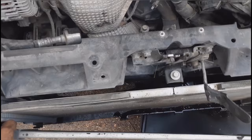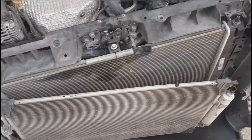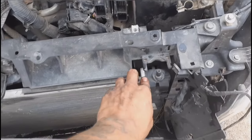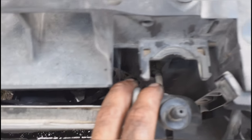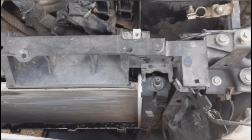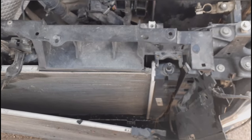After that it's pretty easy to remove — everything is already taken out. Just go ahead and take it out of the way and remove the radiator. The only thing on this side is these lines, but as you can see they curve down, so pay attention that you don't bust them whenever you're trying to work around them.